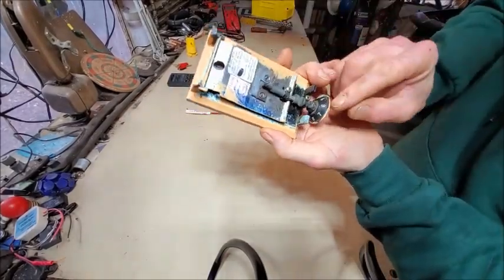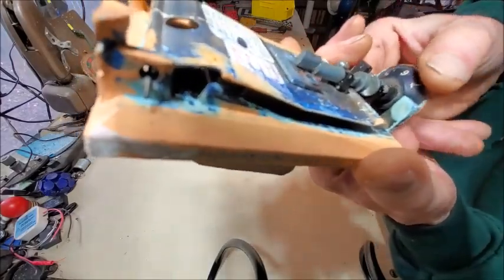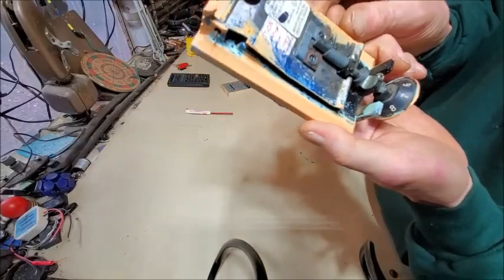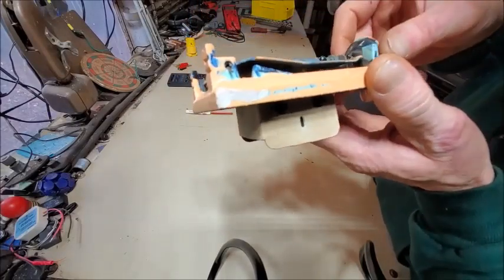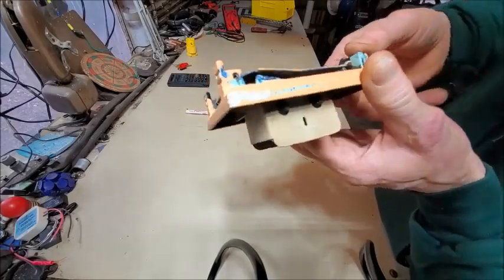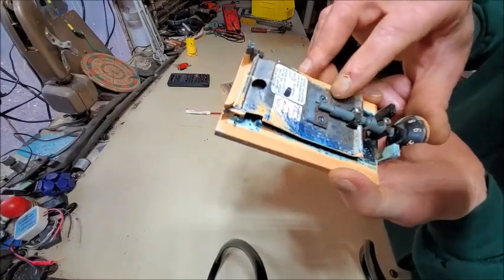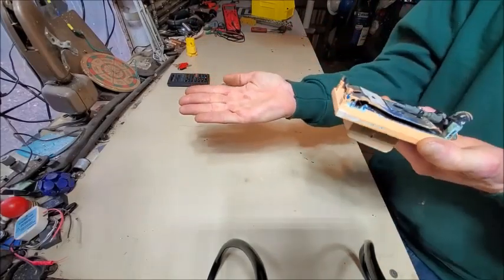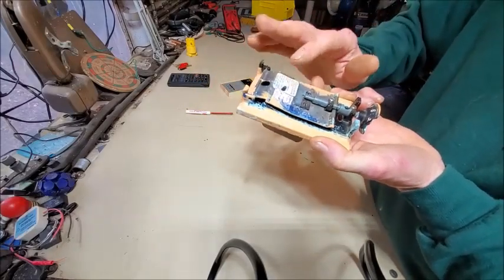This is the thing the human interfaces with — these numbers here. The 5 represents 50 degrees, that's 60, that's 70. If you listen close, hear that clicking? What's going on is the way this metal is designed — it has a cam right here, machined in such a way that it pushes this metal. This metal here is stamped with thermal, temperature-reactive information, meaning that at a certain temperature it'll change shape. This whole metal plate here is the actual calibrated thermostat.